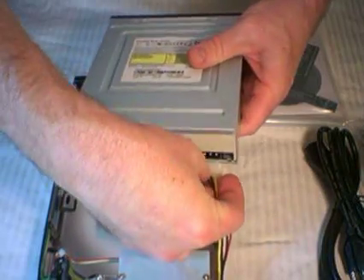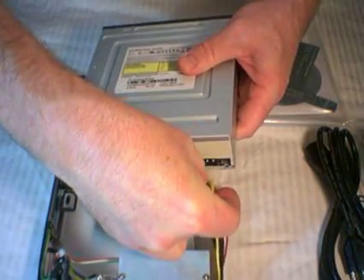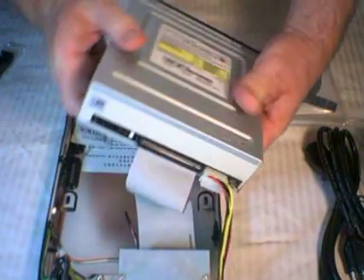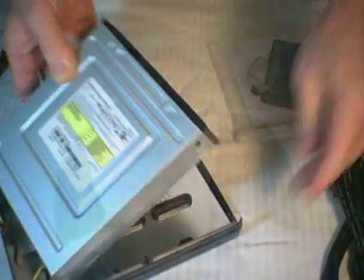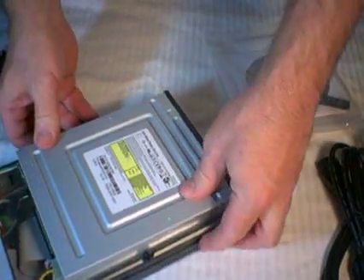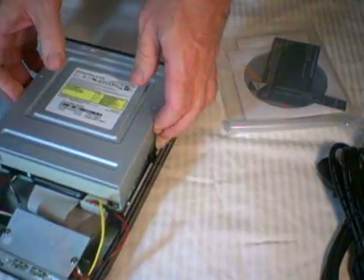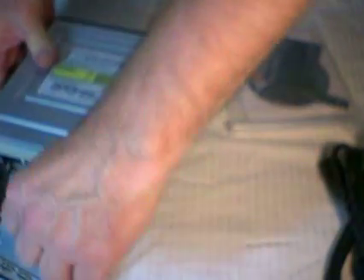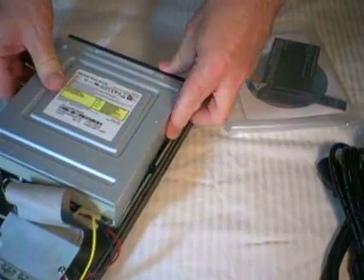Look at it and you'll see what I mean. You can plug in the audio connector, or not, as you wish. Now, place the burner in the case. Avoid pinching any of the cables. The wide flat cable is fairly stiff, so curve it to get it out of the way. Once you get the cables on, you'll attach the burner to the case with the four included screws.